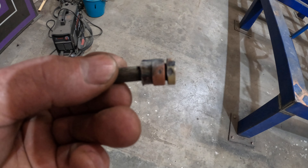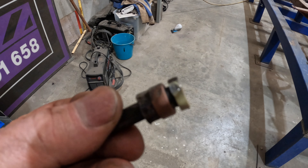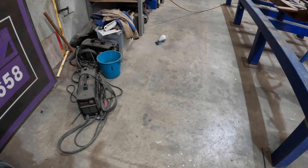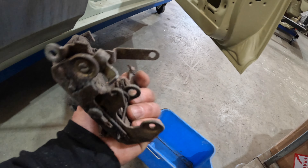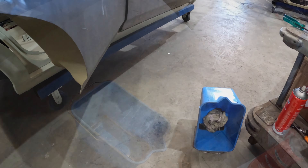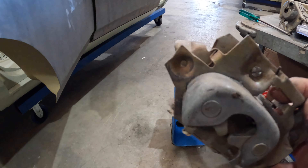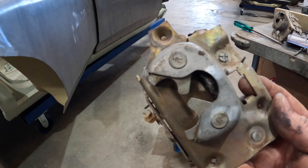I'm probably going to be replacing the same thing on the passenger side as well because the two front door hinges take probably the most wear. I've put new strikers on and fixed that front hinge, but the latch is pretty grotty so I'll just give them a little bit of a cleanup with some brake clean and then fit them up and see if we can get this door to close. Found this door latch mechanism just laying amongst the parts - looks almost new old stock, beautiful. We'll go ahead and stick this on the back door.